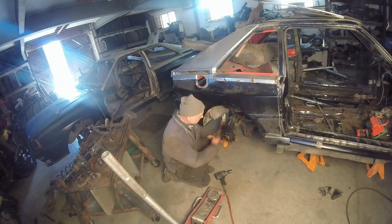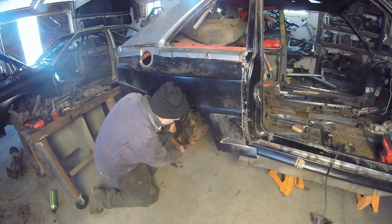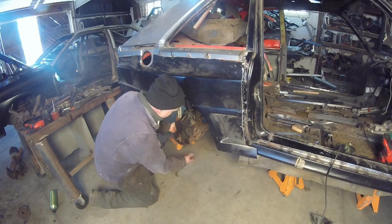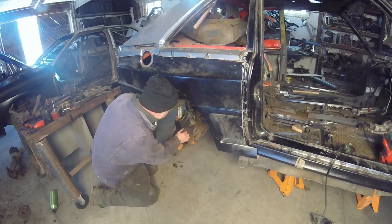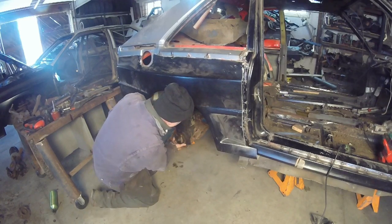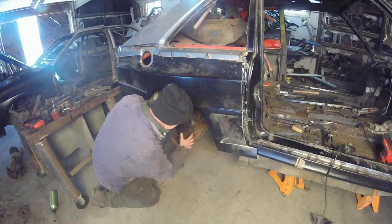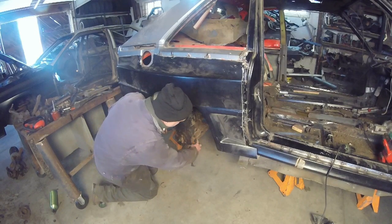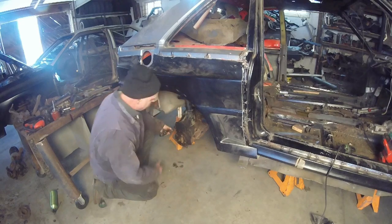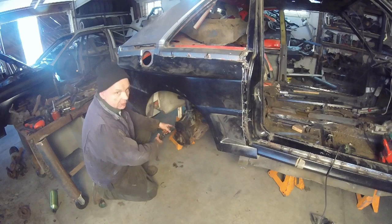Let's take a look at the control arm. Here is the 4000 strut. This is the original ball joint carrier or mount or whatever you want to call it. As you can see, we now have a wider track. There we go. And I still have to come out a little bit more to be free floating. This is relatively straight. What we got here, seeing how this is out at least another 2 inches, we need to have a tie rod end here that's another 2 inches.